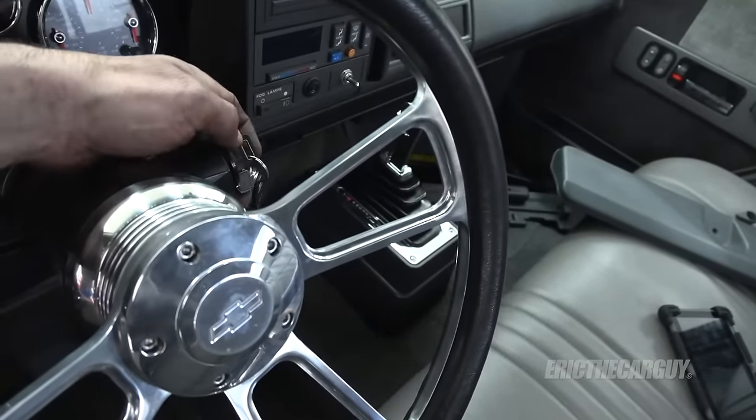Here's something of a pro tip — I actually got this from Humble Mechanic. This is a seam ripper, and it's excellent for going up into wiring harnesses and opening up tape. You basically stab it through, there's a blade on the inside, and push forward. It cuts the harness tape open very nicely and if you're careful there's no damage to any wires. They're only a few cents but I've found this extremely valuable for work like this.